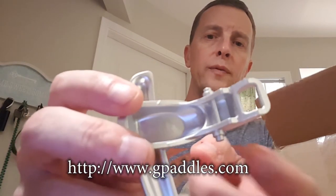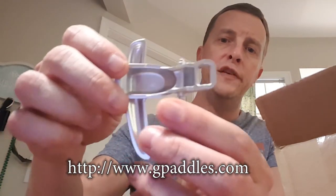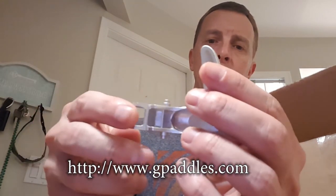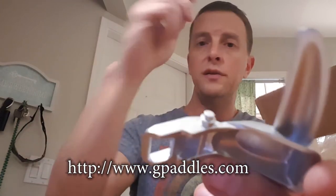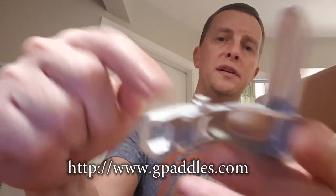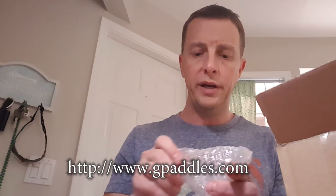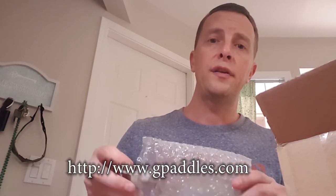That's G Paddle number one. So there's the mechanism — these two pins right there, they fit into two little circles that are pivot points. This part presses the actual button, and this part would be the left side I believe, so when you pull it towards you it pushes the button. The part inside the button holder that goes around this pin is what people usually break off.